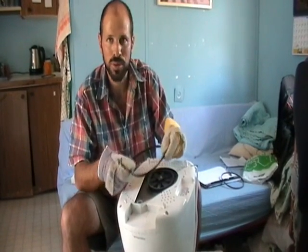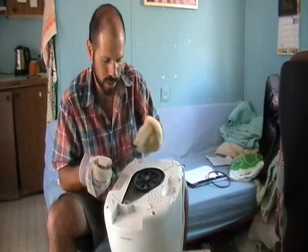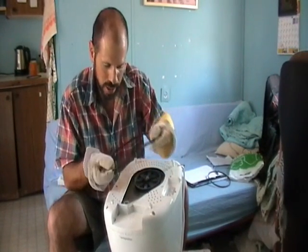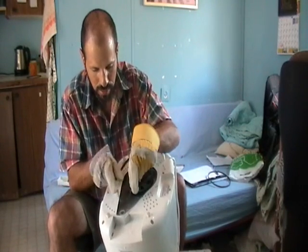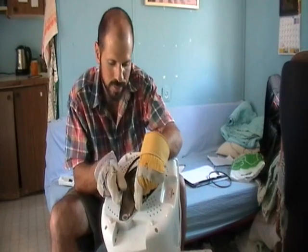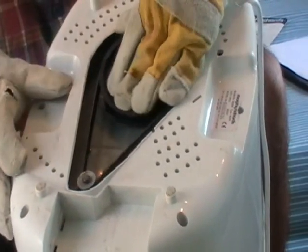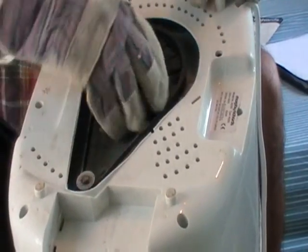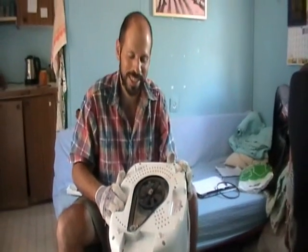If you do want to try the old one for a bit before putting a new one on, here's how: first loop the belt around the small wheel all around, then start putting it on the bigger wheel and turn it around — and it's on. The bread maker is ready for the next baking!